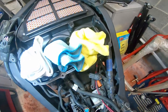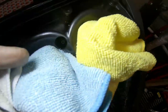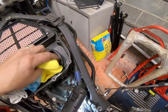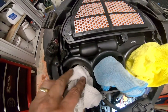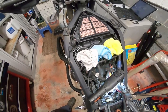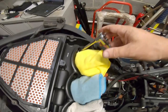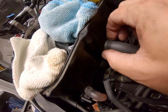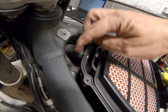The next job is removing the airbox to get at the spark plugs, which means undoing this hose first. There are some screws down here — one there, one there, one down there, one there, one there — a few of them to undo. These are 4mm allen key screws, whereas everything else so far has been Torx. Once loosened, lift the airbox off. There are two breather hoses to disconnect — they have two little horns, so get your pliers either side, squeeze together, and the breather pipe comes off. When you refit these, make sure the horns are at the top.